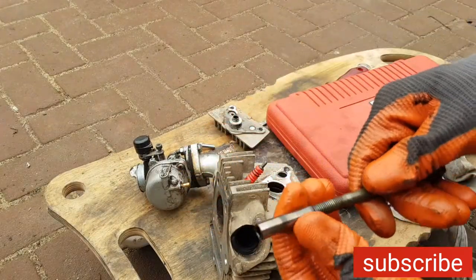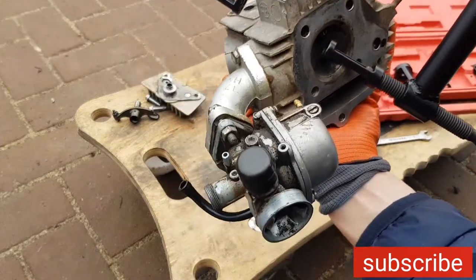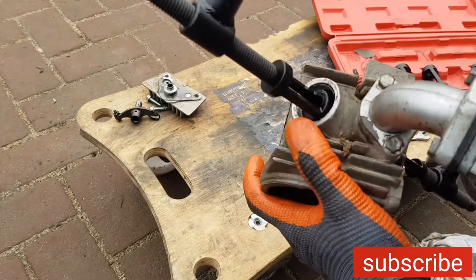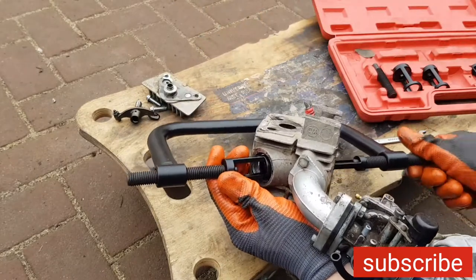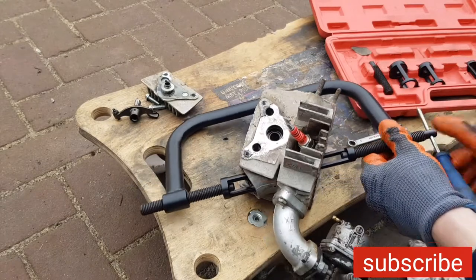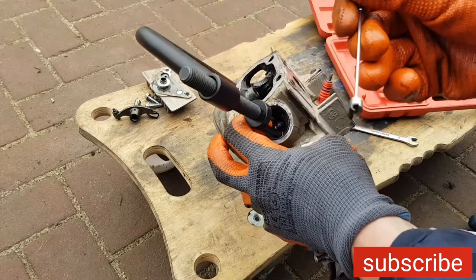Pull this out, then you search for the correct sizes. Make a little bit of room and put on this side the small one, the big one on top. Has to have a little bit more room - let me fix that, just like this. Perfect. You can compress the spring, start tightening the spring. Then you have to have a little magnet like this to pick out these little keepers.